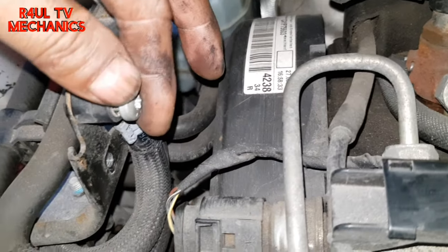Well, that is it guys — all done and dusted. VW Caddy, 62 plate, and we've done the manual regen. If it's a VW Golf, some of them have the automatic regen — you put it on regen and it does it itself. I've cleaned it out, looks good, drives good. You don't have to go down that route — you can take the DPF filter off and replace it with a new one. But just try it; can't do any harm. I hope this video helps you guys out. Please like, share, and subscribe. Hit the bell button, leave a comment. Raoul TV, Team R4UL — we'll see you guys next time.